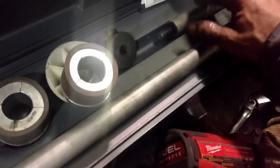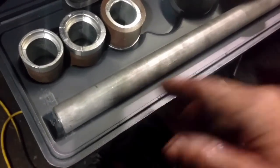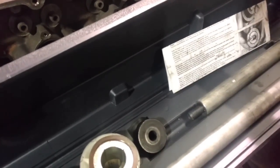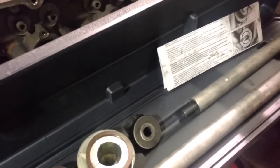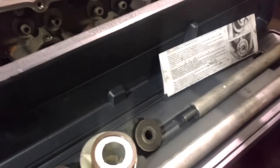You want to line up these splits here with the splits in this. You'll tighten this down, this will expand to fit the cam bearing tight. To get all that in there, you can screw this rod onto this one. It'll do truck engines, tractor engines, pickups, or race cars. $150 at Summit Racing — you can't beat that.